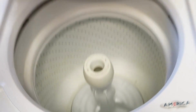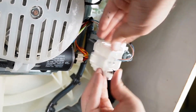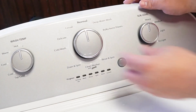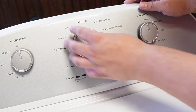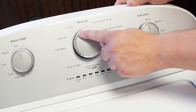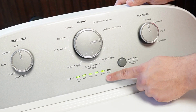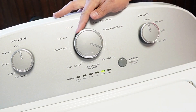Now that we've done the first reset, let's go ahead and attempt to recalibrate this washing machine through the calibration mode. This is a must-do if you've installed any new parts — from a board to a balancing rod. With the washing machine freshly rebooted, rotate the dial counterclockwise 360 degrees. Then turn the knob right three clicks, left once, then right once again. You need to do all these things within three seconds, and it may take a few attempts — if done right, all the lights at the bottom of the control should flash on and off, showing that you've entered diagnostic mode.